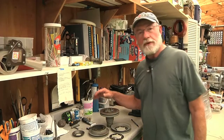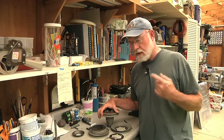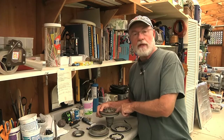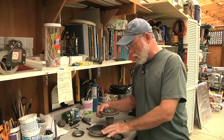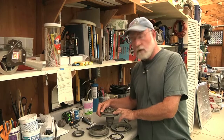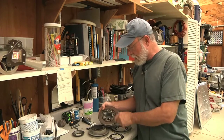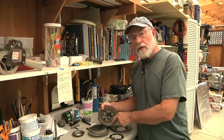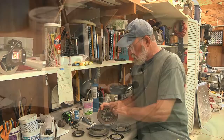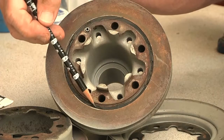As long as we're rebuilding this motor, let's talk about other things that could go wrong and may need some attention. One of the things I found is the harmonic balancer. I took off the pulleys from the main part of the harmonic balancer just so I could look at the vulcanization of the area which holds the outer ring — the outer pulley ring — onto the hub. And what I've seen are some areas showing that this is devulcanizing.